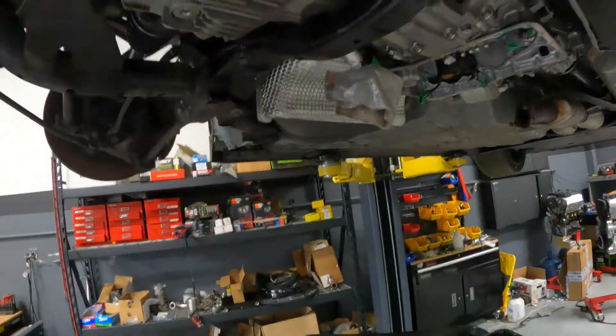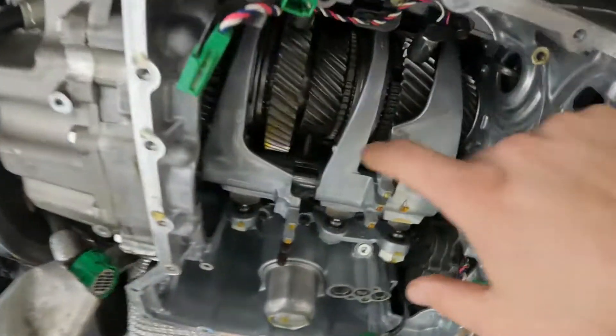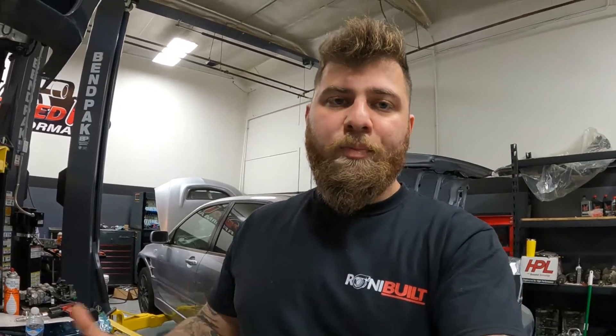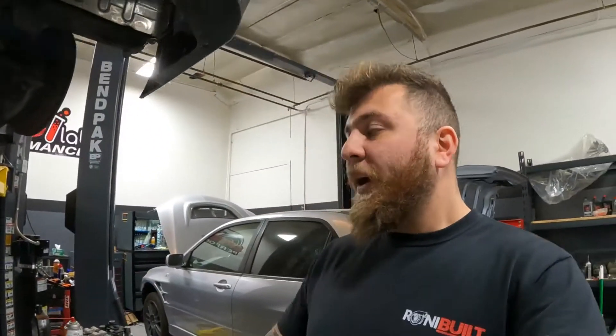So I want to explain how the GR6 unit works. The GR6 is a rear-mounted transmission. It's a DCT — dual-clutch transmission — which is essentially manual because these gears have synchros on them. The way a dual-clutch transmission works: you have two clutch baskets and two shafts — one for even gears, one for odd gears. Your next upshift is always pre-selected, so as soon as you hit that button it takes about 40–50 milliseconds and the TCM switches to the next gear. That's why DCT is such a superior transmission — no human can shift that fast.